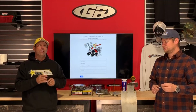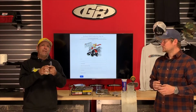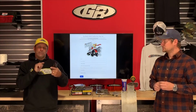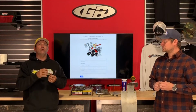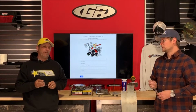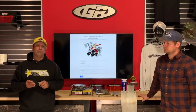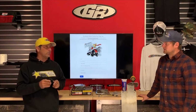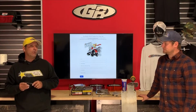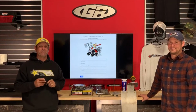And by the way, 2.5 is the first piston that's big enough inside the shock that they can do the detail they need to actually start to make the valving really work well. If you ever get a chance to talk to somebody from King, they don't consider the first real shock until you get to a 2.5. So that's why I'm going to 2.5, that's why you're going to 2.5s, that's why Jamie's going to be on 2.5s.